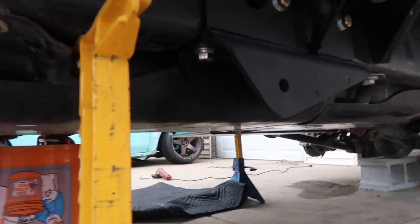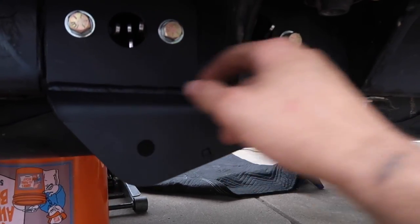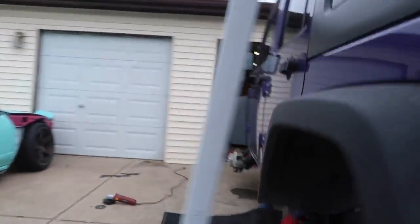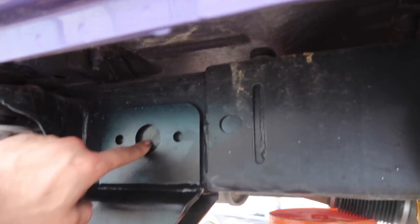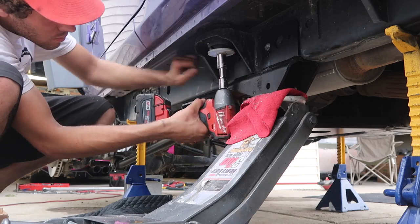We got this bracket entirely mounted. We had to drill the 6 holes and then use the hole saw and get these big ones out of there. It wasn't too terribly bad, but I'm gonna go ahead and do the other side. I've got it mounted up there with the jack, and you just basically use this as a reference and drill your holes. And I'm gonna go ahead and do that now. Once this is bolted up, we can actually start putting the control arms on.